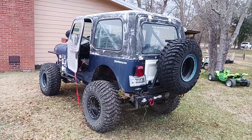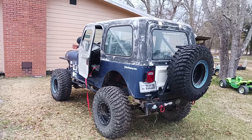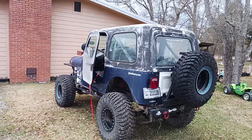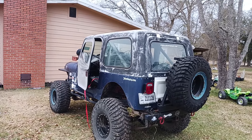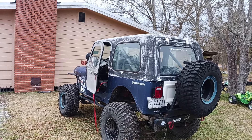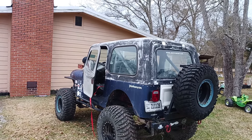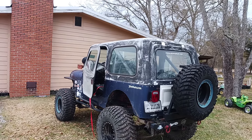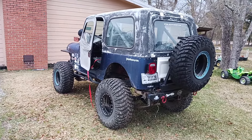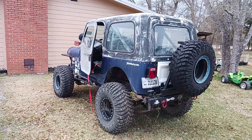It does run very good now, it just smokes a little bit, so we're going to see what we can do about that. We're going to take the head off of the cracked block that I bought and see if we can rework it and possibly put new rings on the 60-over pistons that are already in the block right now, and see if that solves the smoking problem. If that doesn't work, I'm probably going to have to put a 4.0 in it, or possibly a V8 — I don't know yet.